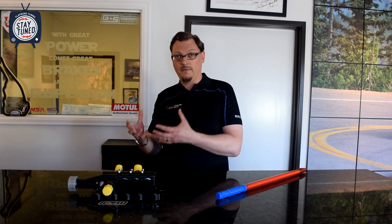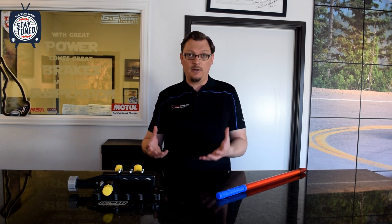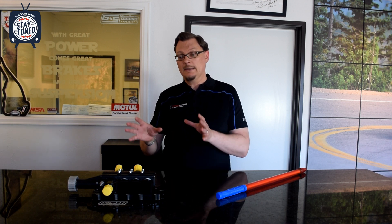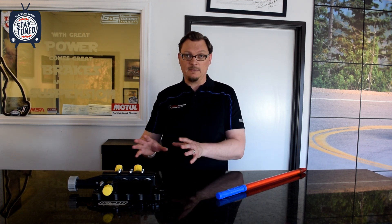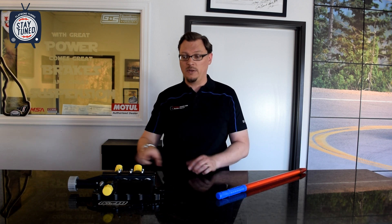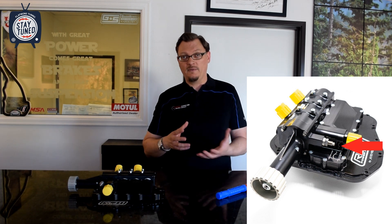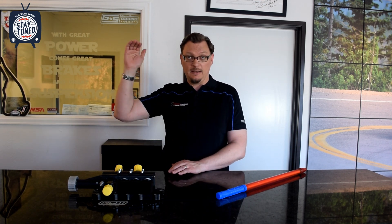So you have a lot more control of the oil pump and the speed. It also eliminates the PCV system. If you're having issues with any one of those things — which is not uncommon on race cars or high horsepower cars — the dry sump is a big help. Most good dry sumps give you very easy access and control of your relief valve pressure. With a stock oil pump you often have to remove it to make any changes, whereas most dry sumps give you a spring or set screw to set that relief valve pressure.